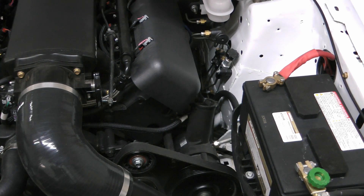For power steering, I'm using the factory Ford power steering pump — it makes the same winding noise as every other Mustang, which keeps the crowd guessing. I'm using the same ICT bracket kit, which I'll link in the description. It uses the factory pressure hose, which is about $40 Canadian, and just a piece of 3/8 hose with clamps on the return side. A 98 Camaro pump for one of these cars runs close to $300, so this is a much cheaper solution.